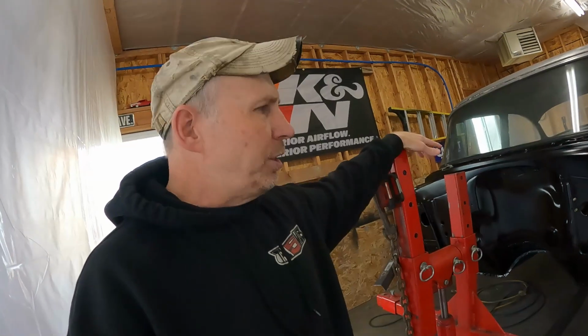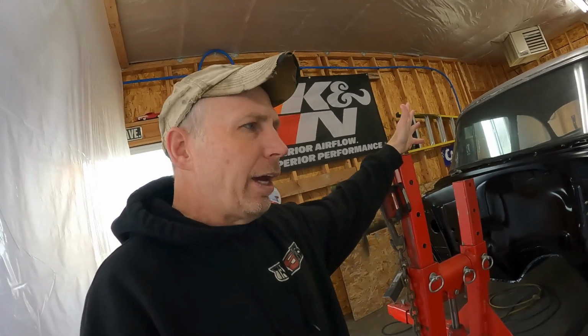So their tech sheet is really good, but it can't cover every situation. It doesn't really talk about spraying the epoxy on top of filler. It says you can, and it doesn't give you a lot of guidance. Now, if I would have had some more brains, maybe I would have called the tech line and asked them a couple questions before I did this, and then this would have never happened. So again, learn from me. If you're not sure, call somebody.